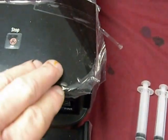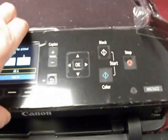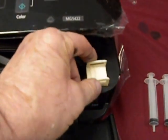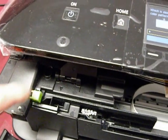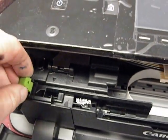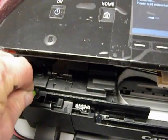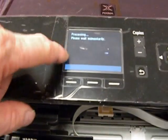The interlock plug sticks up a little bit, so when you go to shut the top, this side will stay up a little bit and this side might drop down — that lid bracket is going to help it stay like that so you'll be able to continue to print. Peel and stick it right about there at the corner. You've got your interlock jumper here — a little rubber jumper that goes in this little hole where the switch is, so the printer thinks the lid is down. If you don't have that in, you can't use the printer. You know when you have it in correctly because you won't get an error message.